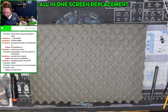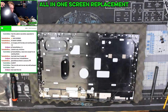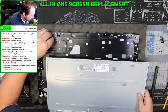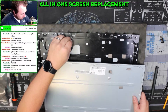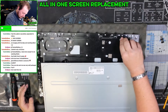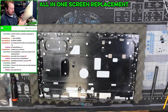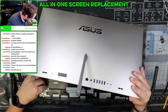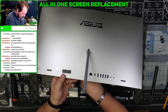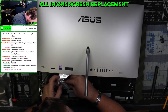We're going to gently set this down. On the back of the bad one we have these little adhesive pads that go in specific places to generate a little bit of cushioning — I want to transfer those over so we give it the safety margins it needs. Just those four is all I'm really worried about. Now for the actual computer: first we have our touch connector all the way over on the left, then touch connector two — which is actually the webcam — and then we have our actual video connector.